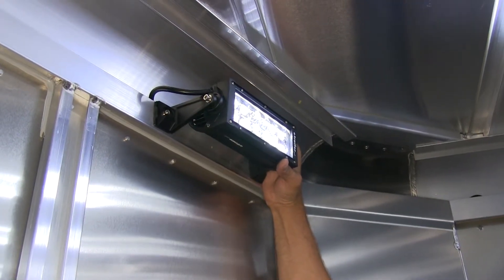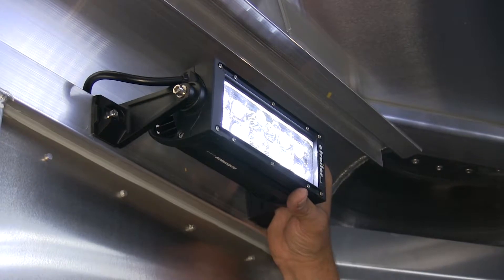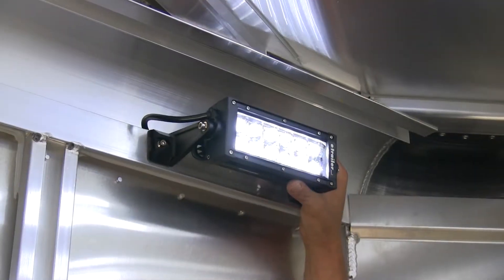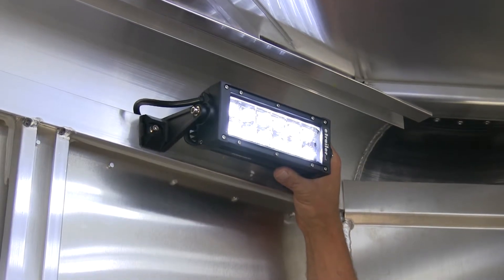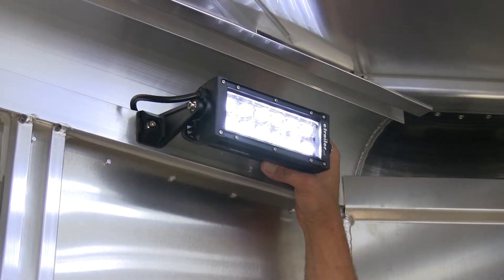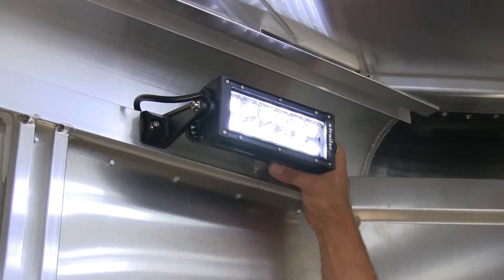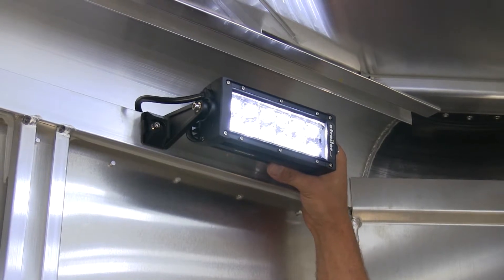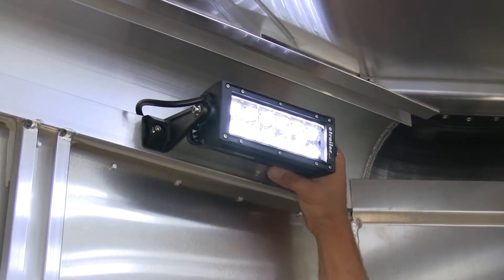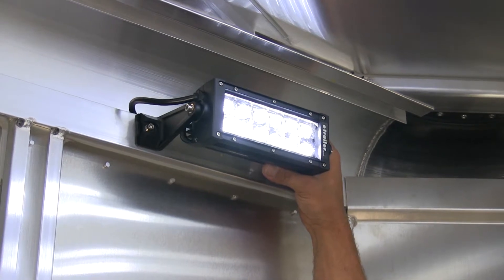The LED lights draw a lot less power than the old incandescents used to. But if you are going to be running it to an onboard 12 volt battery source, pick up a relay kit to put in line and make sure your switch lasts a very long time — you won't have to constantly replace it. Overall, comparing this with other LED light bars out there, I definitely think this is going to be one of the better of the bunch. It's not quite to the level of the Vision X, which is the very highest level of LEDs available, but it does effectively transfer the lumens and light up an area very, very well. It puts out about 1550 effective lumens — very bright compared to a lot of other lighting systems we've been used to in the past.